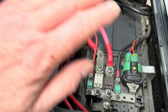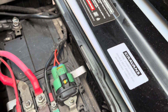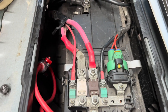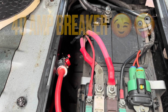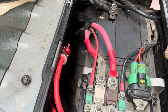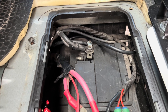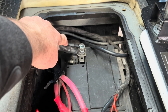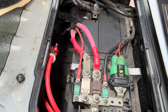Just to confirm — the battery is at the front here by the caravan's double swivel seat, which does impede a little bit. We've got a 40 amp fuse going onto the cable, which runs straight back to the DC-to-DC charger, as well as a negative or earth cable running all the way to the back of the van.